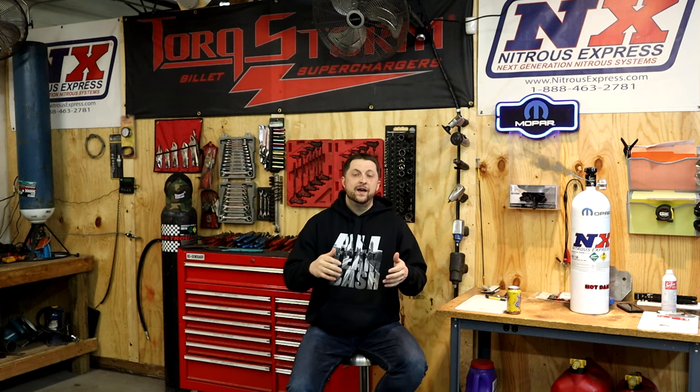You want these mufflers directly in place of where your old resonators or mid mufflers would have been in the middle of the vehicle. That way they take out a lot of drone and get rid of that raspiness. If you move them back towards the rear bumper it's actually going to create a lot of rasp and drone. Put them right where the mid mufflers or resonators used to be — that is where they sound the best. This combination gives you a super deep growl on startup and idle.